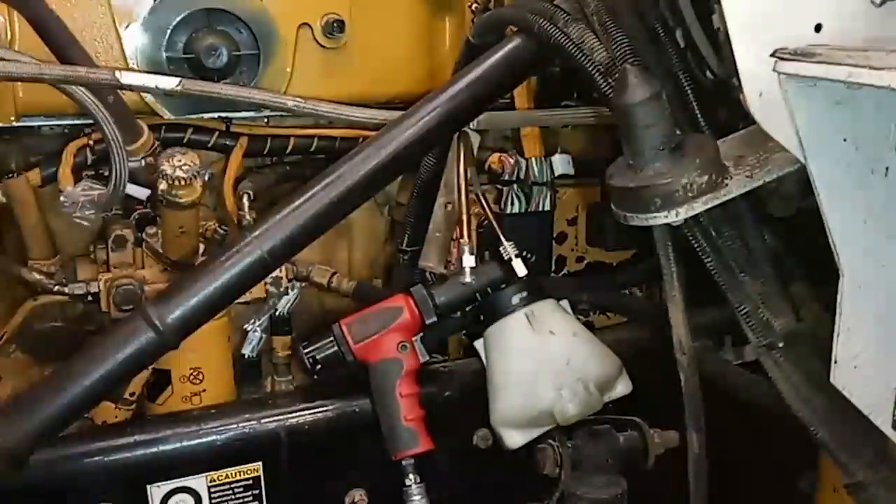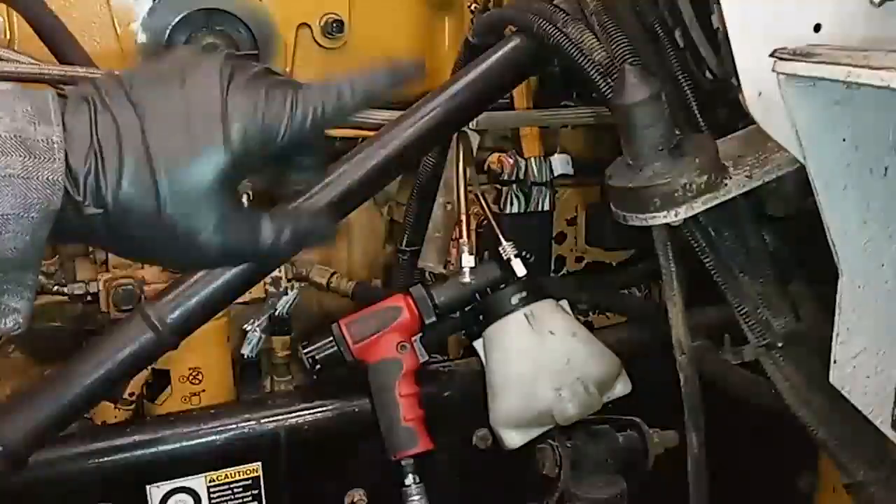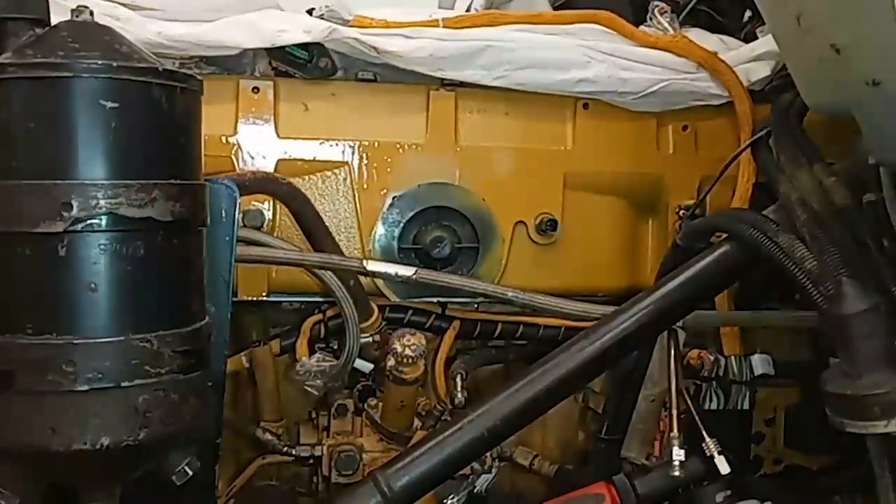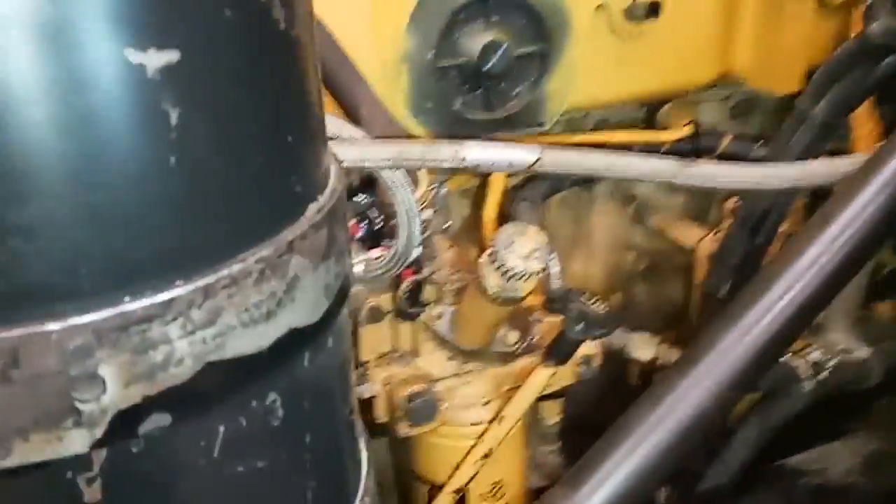There might be a very small amount of air remaining, but there's always a tiny amount — if you've ever seen an engine running with a clear fuel line, it's always sucking a small amount of air. Remember, the cylinder head is the highest point in the fuel system, so if you don't do this it's going to be very hard to fully purge the air.